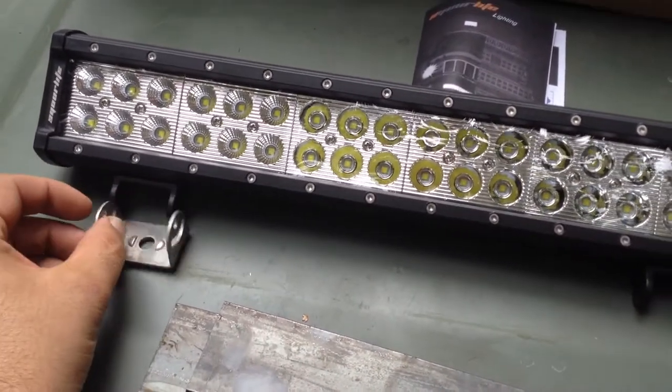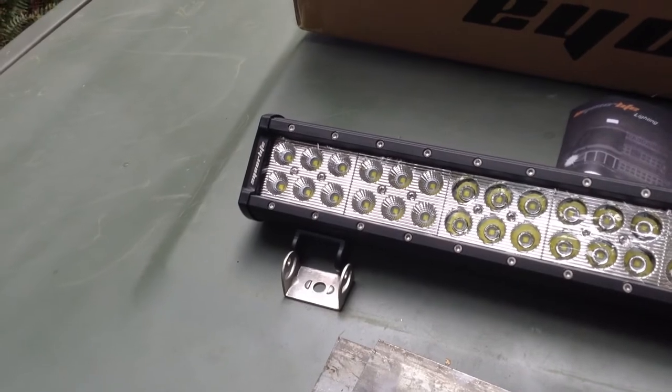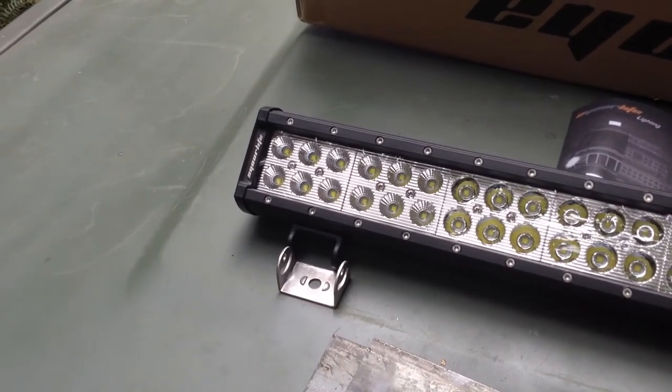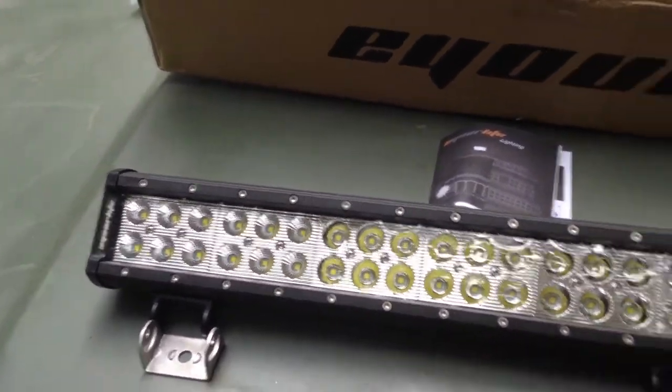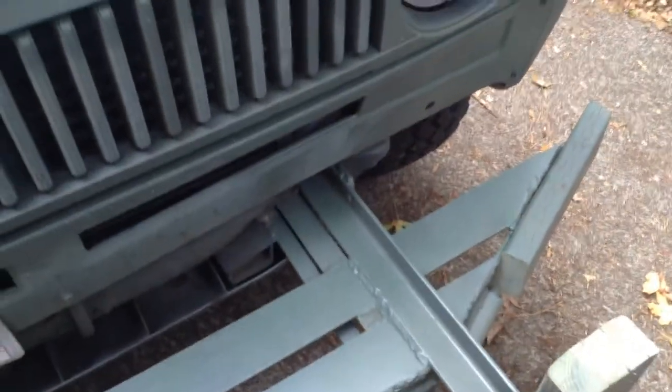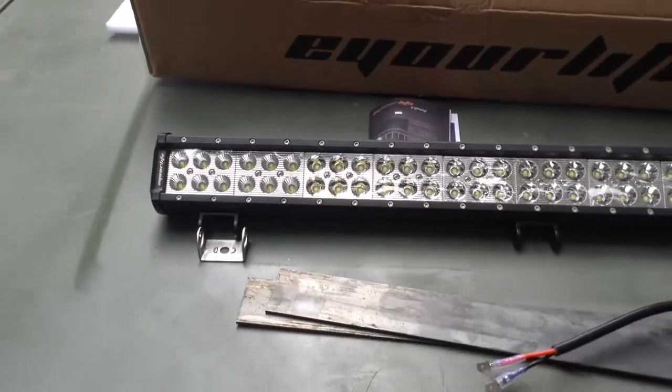As far as angles go, adjustment is pretty much limited to the bottom of the bracket. It can lock in place. With this custom bumper setup, I'm cutting some metal and making my own hardware. What's fashionable right now is CNC laser-cut, stealth fighter-looking shapes on front bumpers, but I don't have a CNC laser plasma cutter. My plasma cutter is not working, so I'm using a portable bandsaw for flat stock.